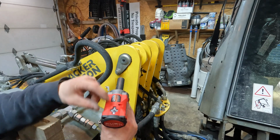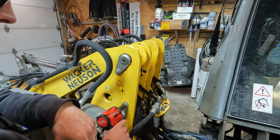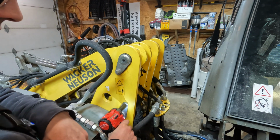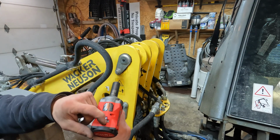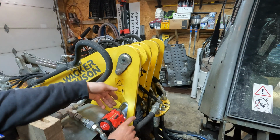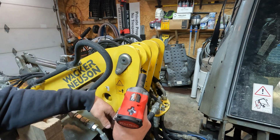But let's say I wanted to run that bolt in, but I really want to hammer it down. I'll put it back on 2, and you can see it turning here. It basically runs that down to close to that 250 foot-pounds of torque. And then if you put it to 3, it's not tightening it anymore, but it's just hammering faster, so you can get that job done quicker.